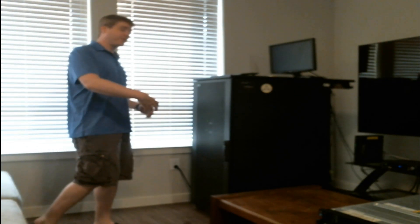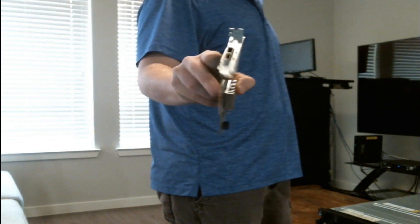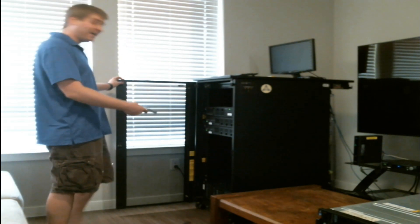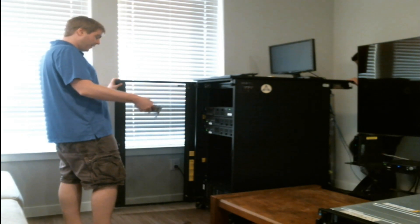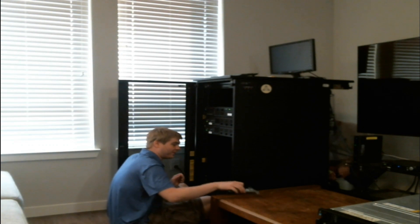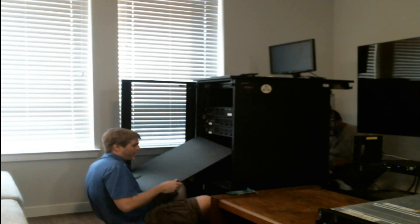Alright, so to start we have to do some hardware work. I'm going to talk about what's actually in the machine. We're going to install this dual SAS card — single card that allows dual six gigabit per second — basically for a JBOD unit. We're going to get this in the DL370 by HP. It's a Gen 6 model with three eight-bay drive bays up front. Power cables out — I always say power cables out whenever you work on anything.